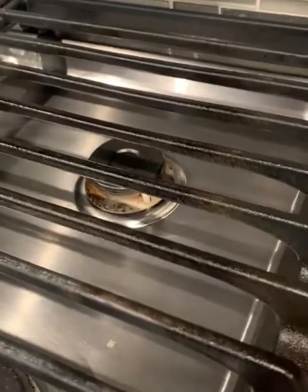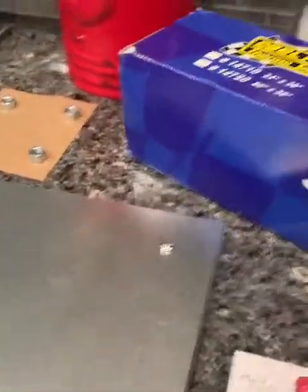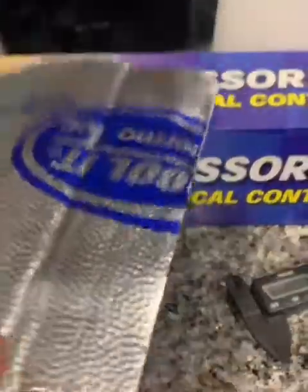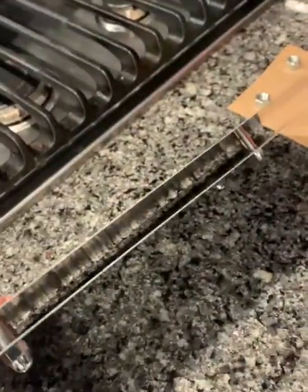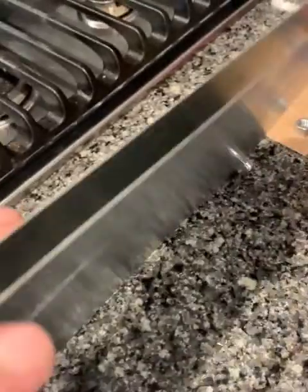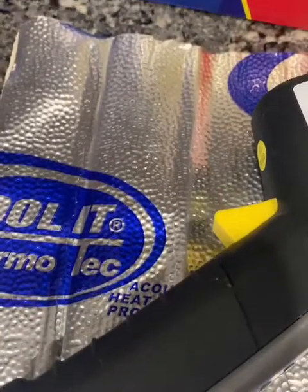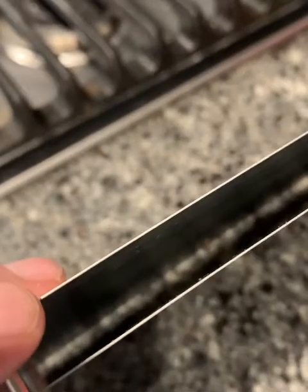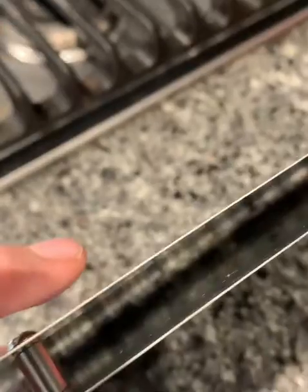Headers maybe won't be quite as hot, but this will give us some ideas of what our heat transfer is - without any insulation, with one layer of insulation. And then I'm actually thinking about doing a double panel. My inner panel would be this one right here, and I'll line that with the Cool-It Thermotech and have another panel on the outside with an air gap of about a half inch.